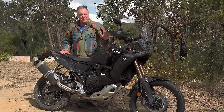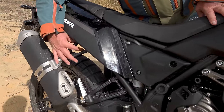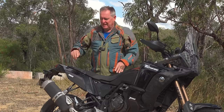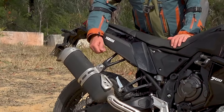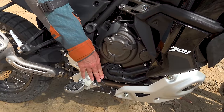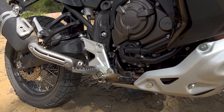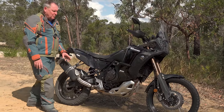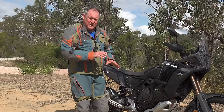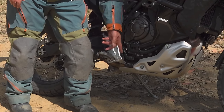While I'm loving the fuel tank and the suspension, it's got a couple of problems. First, the mounting of the exhaust pipe — still the old design with two bits connecting onto the frame. If you fall heavily it can bend the frame inside. The other issue is the rear brake — it's always been renowned as spongy. A couple of people have now put aftermarket brake pedals on and that's eliminated the problem. The actual braking assembly is fine; it's just the stainless steel brake pedal that makes the brakes feel spongy. The good thing is if you bend it, you can just bend it back down.